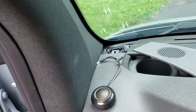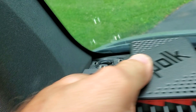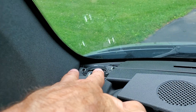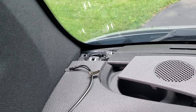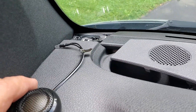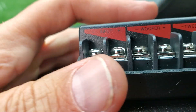What you've got to do is use this crossover that comes with the Polk speaker — you can see the input contacts here. That speaker wire was hanging out right here from the factory head unit. I pull it down; it's really easy to reach up under the Sprinter without even taking any panels off to get to that wire. You pull it down, cut the factory connector off, strip it a little bit, and it's just long enough to wire into these contacts.